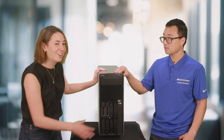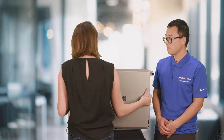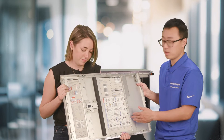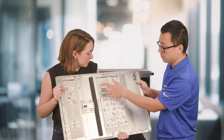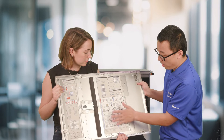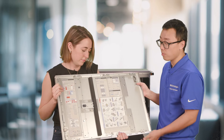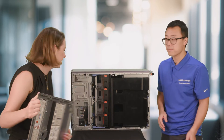Awesome, let's turn it around. Now that we have the lid off, it looks like there's some information on the other side. This is the most basic and important information for the system — on one side it's the service information, and on the other it starts with memory information telling you how many memory slots there are and how to install them. At the bottom you can find diagrams showing how to install basic components such as the boot card and heat sink. It's very straightforward and easy-access information for when you first open this product.